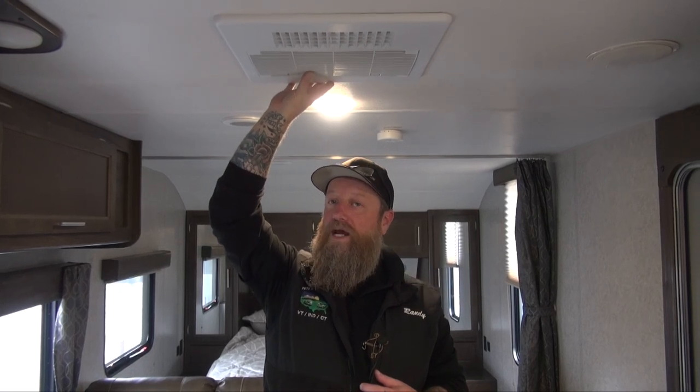When I get to the campground on a hot day, the first thing I do is turn on the air conditioner and open the quick cool option. Air conditioners don't make cold air — they remove heat and they remove moisture. By running as much air through the evaporator coil and the condenser coil, that's how we're going to cool a coach down, and the quick cool option is going to allow us to do that.